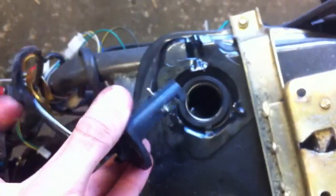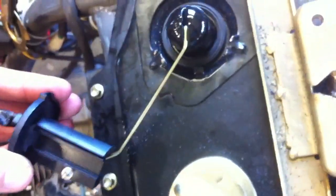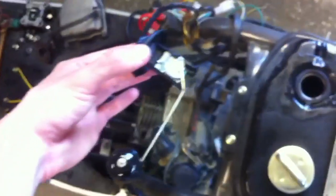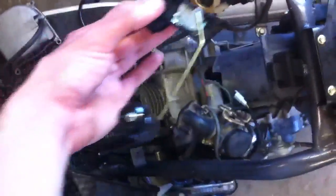I'm just going to wiggle it around and then it comes out. After I wiggled it around that pin that's sticking out — I could actually cut the pin so it'd fit better. So this comes up and there's a float, and then you got to twist the whole thing sideways and pull the float out. The float has gas on it because I fixed it just a second ago. Here's your float mechanism that measures the fuel in your fuel tank. The float is all the way up because I'm leaning back.